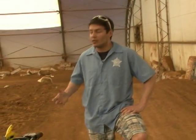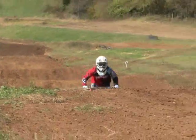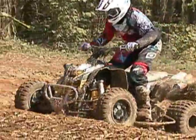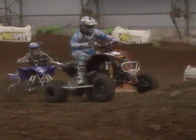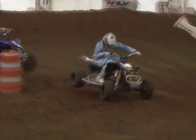When we tested this bike back in October, we had it bone stock. What we mainly noticed about the suspension is that in stock form it's probably the best 450 on the market as far as plushness and the way the suspension works up and down and feels underneath you. The biggest problem was that we couldn't get the bike to sit low enough, and it wanted to roll in the corners because of its high center of gravity.